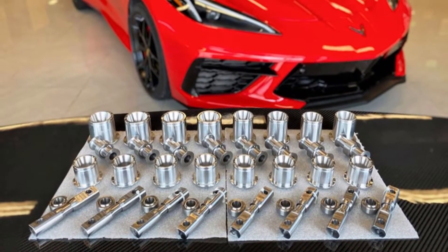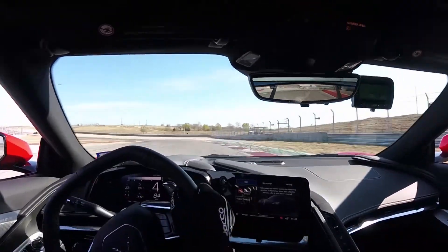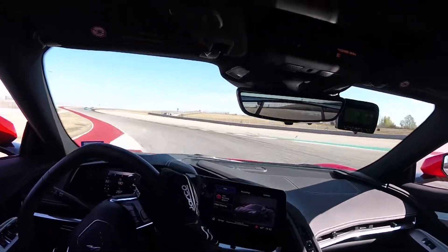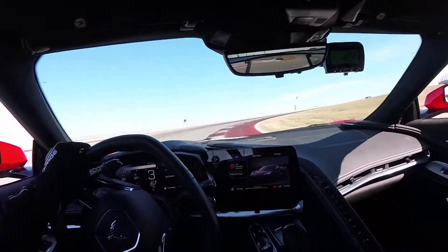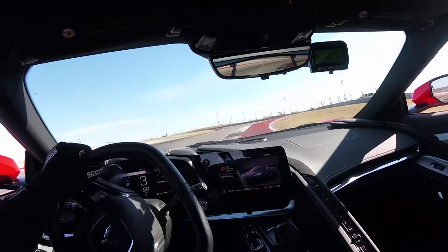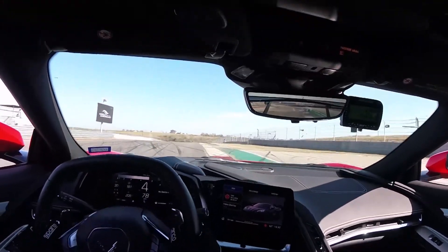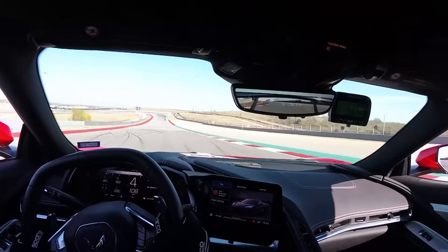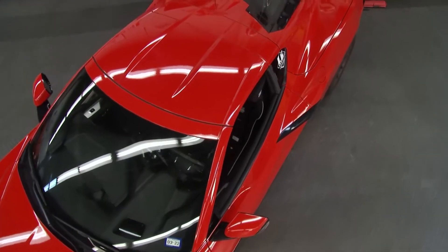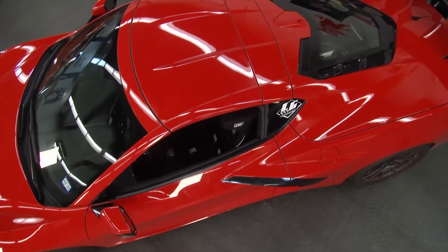Beyond the monoballs, the car came with a lot of body roll going around turns. We came out with some sway bars that really plant the car around the turn and reduce that roll drastically on the track. As a racing driver, staying consistent is definitely important — if your car is rolling over because bushings are deflecting, it's not consistent in a turn and you can't really push it.